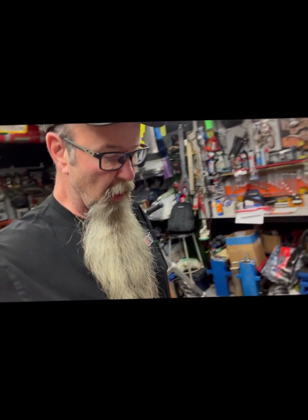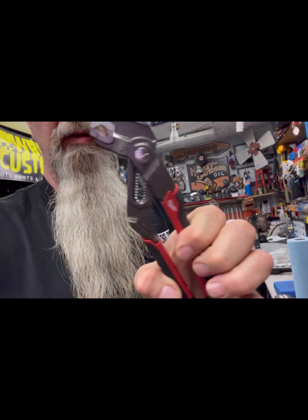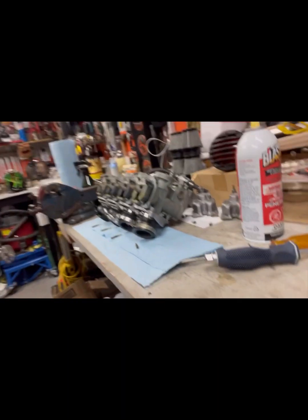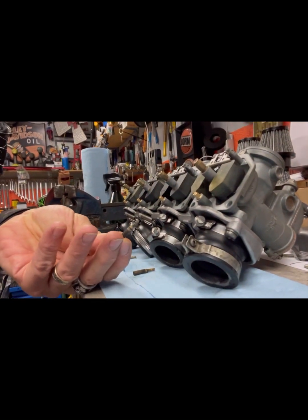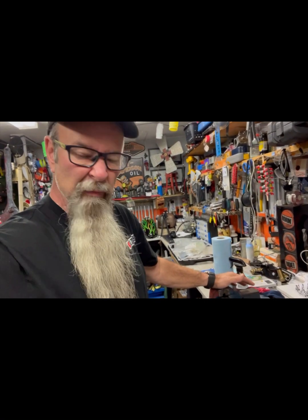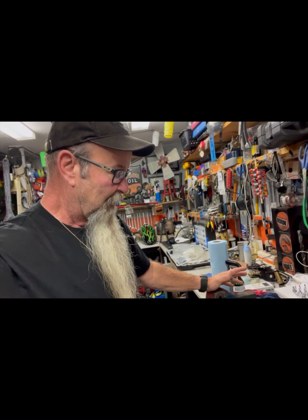Update - it works! I put the pliers on the first one - very, very stiff - gave it a little squirt and look what I got out: all four. There's the pilot jet. I need a little piece of emery cloth to clean it up - it's very dirty. See if I can see a number on it - I need to go in the basement to get that. Anyway, there's the update, thanks a lot.